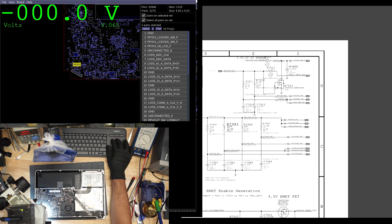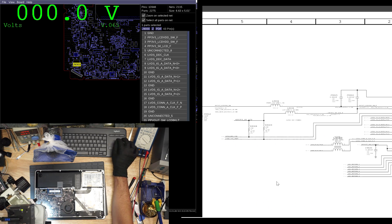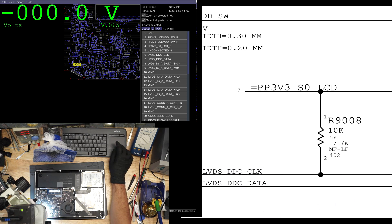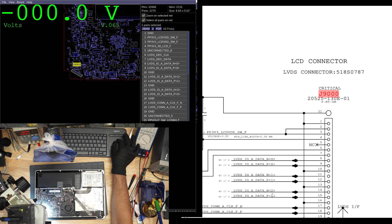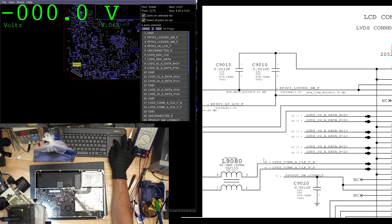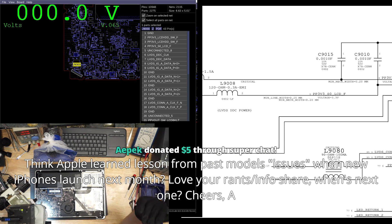There are a couple of different power lines for your LCD on these MacBooks — it's not like an iPhone. You have PP3V3SO_LCD going to pin 4, which goes to the DDC part of the LCD. DDC is a protocol used to communicate what type of screen it is — resolution, refresh rate, model. That has to happen first. Second, you get 3 volts to the LCD image circuit on pins 2 and 3. Third is backlight on pins 21 and 22, and that's the last to come on. It follows this order on older MacBooks that use LVDS. First, 3.3 volts for the DDC circuit; behind it are the two pull-ups for LVDS DDC clock and DDC data — that's how plugging in a new screen automatically communicates resolution and all that.